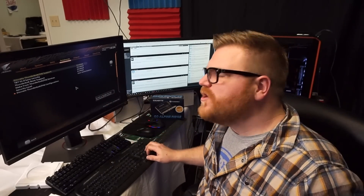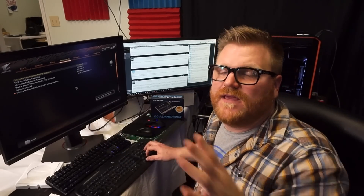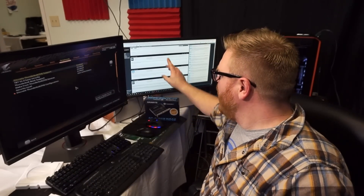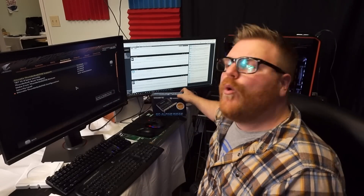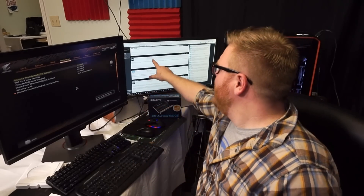I have no options like that. I tried every configuration from the first to the third PCIe slot, took the discrete graphics card out, and even turned SATA and NVMe off because I thought maybe it shares PCIe lanes and you have to disable them for it to work. I was almost ready to email my Gigabyte rep and just return the card. I thought maybe it was faulty since it was open box. But then I found a Gigabyte forum post where someone says 'I found a fix for this' - the exact same problem as me.